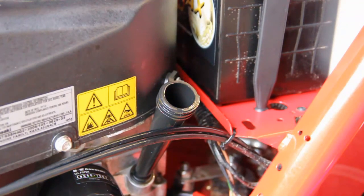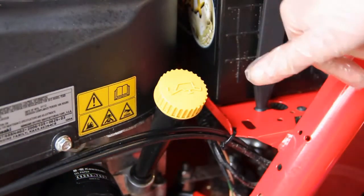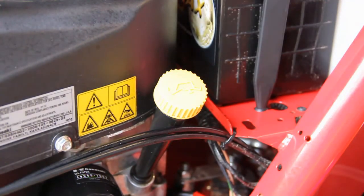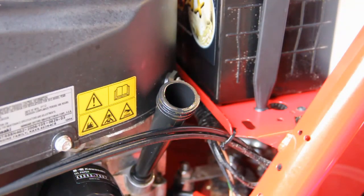Once you've waited two or three minutes, put the dipstick back in. This will depend on your engine — whether you have to screw it in or just balance it on the top to read it, because it will affect the reading on some engines. Then just take it out again and see the reading. If it's at the right level, go ahead and start your engine and run it for about two to five minutes. Then check the oil level again, because your oil filter will affect the amount you need. Double check you've put the right amount in, and if it's not at the right level then add more according to how much it's supposed to have.